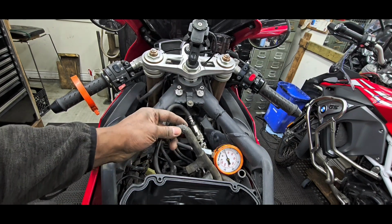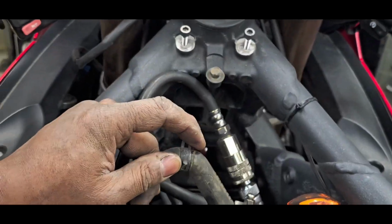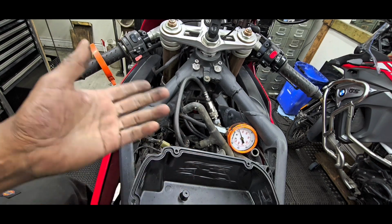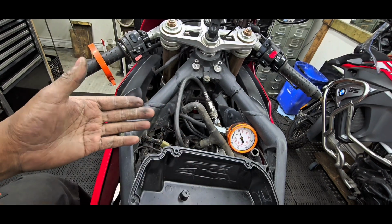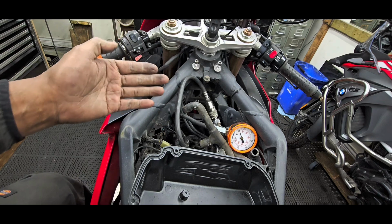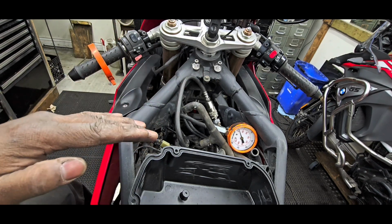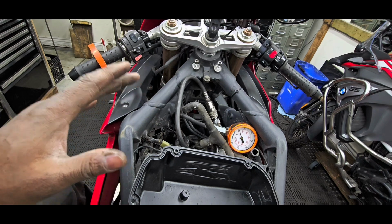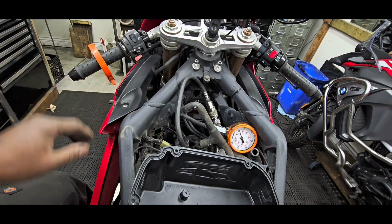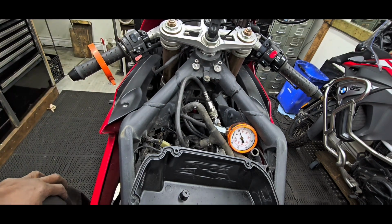But you know, there are just so many things that we are finding. The stator wires tested good, but I haven't been able to do an output test. I haven't even been able to find the reg rec. When I took the plastics off, I found things dangling, cracked, and broken. It's ongoing, so we sort of need to prioritize what's needed. In my opinion, it kind of needs everything so that the bike is not only reliable, but also safe. Jeepers. Okay, let's figure this out.